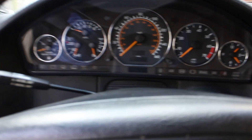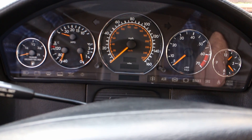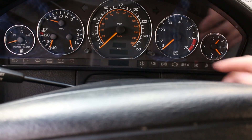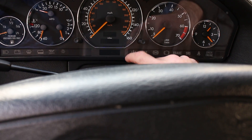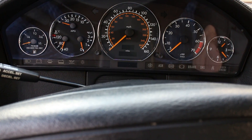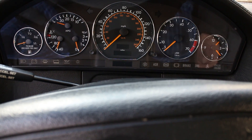The test car is a 1995 S600. In many cases, what's going to happen is you're driving down the road, you press on the gas pedal, and suddenly your ASR light comes on, ABS light comes on — sometimes only ASR — and the car goes into limp mode where you press on the gas and do not have any acceleration. You have to press the gas pedal further down and will have very limited power. That's how limp mode happens.